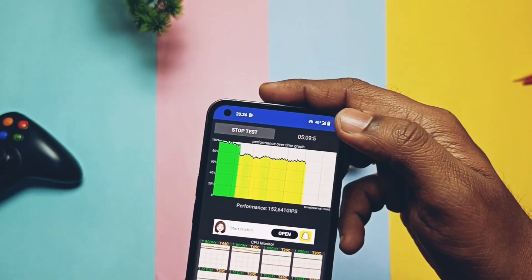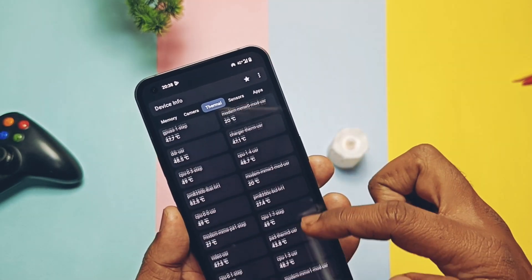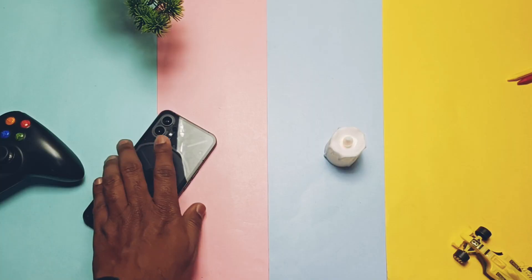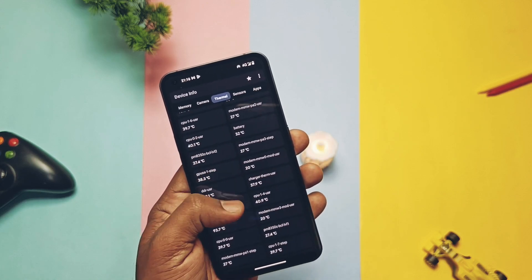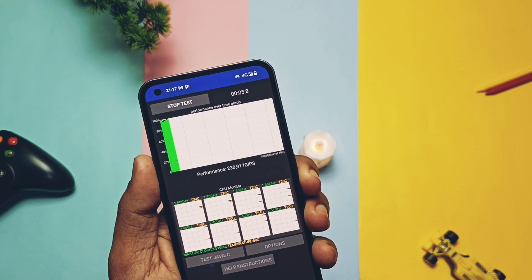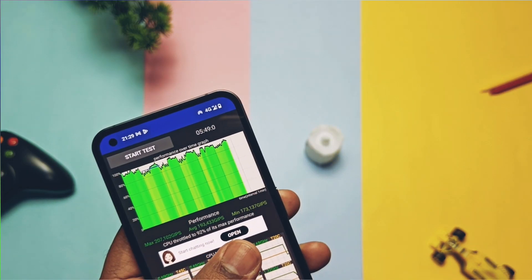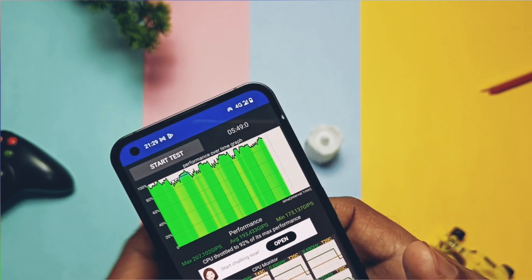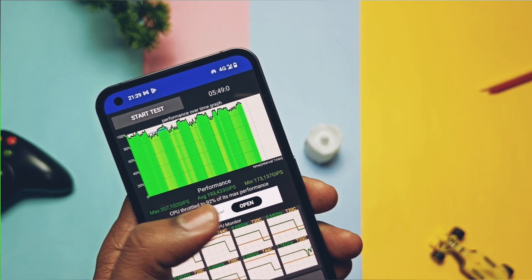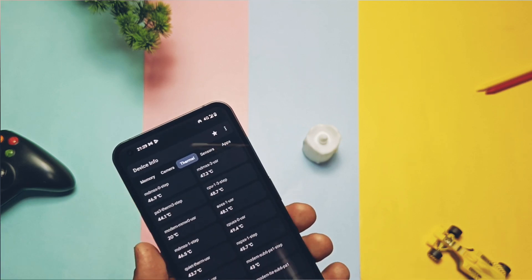Suddenly, after about two and a half minutes, the graph line turned yellowish and when I stopped the test I got a score of 77% throttling. CPU temperature during this test rose to between 47 and 52 degrees Celsius. I cooled the device down to 32–37 degrees Celsius and ran the test again — the graph looked okay this time with some fluctuations, scoring 92%. This throttling issue has been present since stable Nothing OS 1.1.7 — first test results are worst, then after cooling the device gets normal scores. Nothing needs to check their CPU throttle governance before the next OTA.